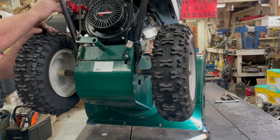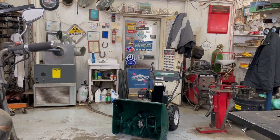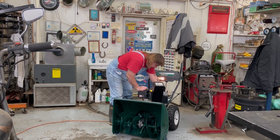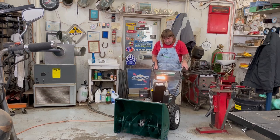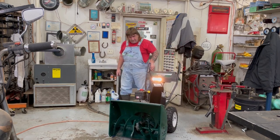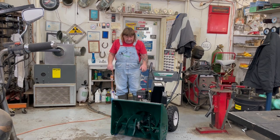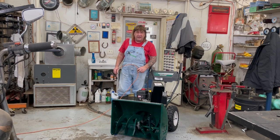Now all we got to do is put the pulleys on, the belts on, and put that cover on, and we'll try starting it. Put our key in. I got it off the table — let me put a little bit of premium gas in there real quick. Grab the extension cord, see if we can get this thing started. Let's prime it, put the choke on. There you go! It's crazy how that starter gear ended up on top of the piston. Anyway, it runs good again — they can go snow blowing. Thanks for watching the video. If you like my videos, please press the like button and please subscribe. Have a good day, bye.